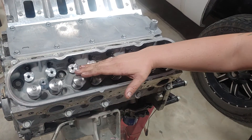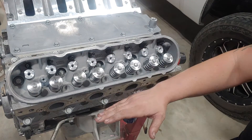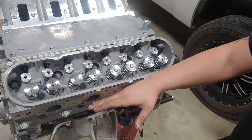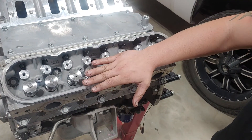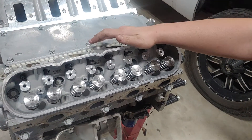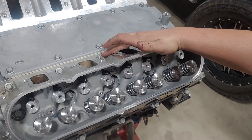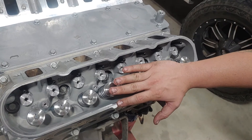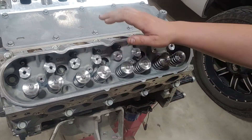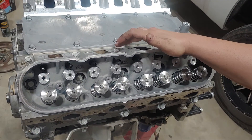Then all your bolts — this middle and the bottom right here — you'll be torqued right here. You don't mess with these until you're done torquing these. You only torque these up here once. These are 22 foot-pounds and that's it. When you get done torquing your three sets, you're going to torque these up here.